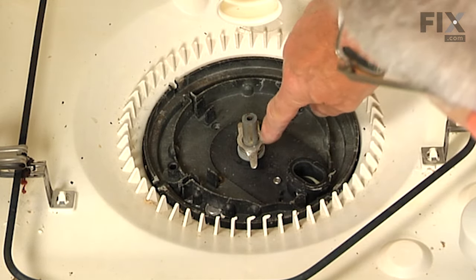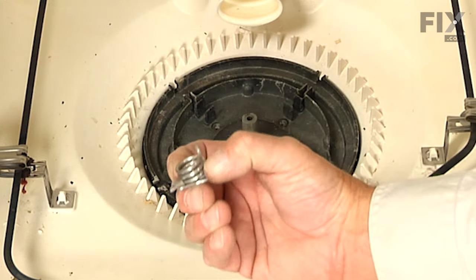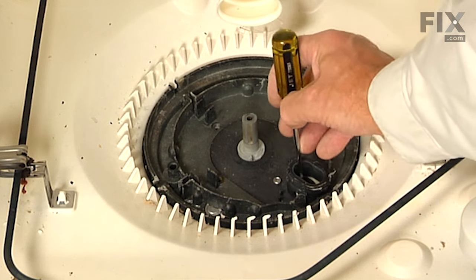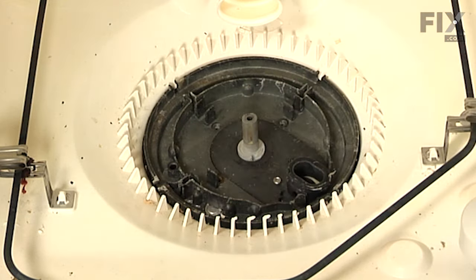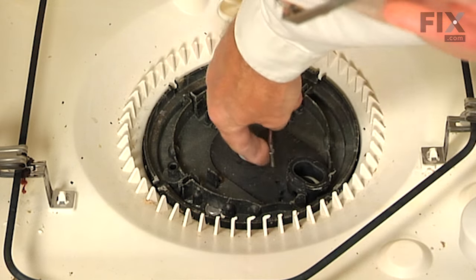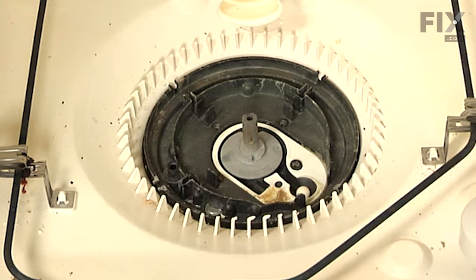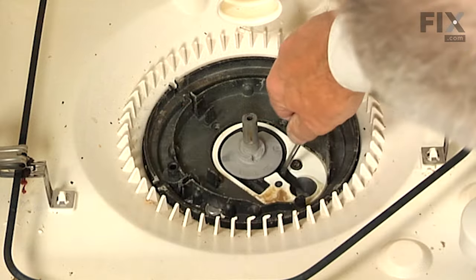Next, we have the chopper blade and the spring, and on some models there may be a bushing that sits on top of that chopper blade — remove those and discard them. There will be an oval outlet in the top of that pump that may have one or two white plastic balls in it. Remove those. Most models you'll only find one on top and the other will be down inside, so we'll next remove that single screw on the oval-shaped cover — it's a number 15 Torx. You can remove the remaining check ball, then lift that cover up and set it aside.